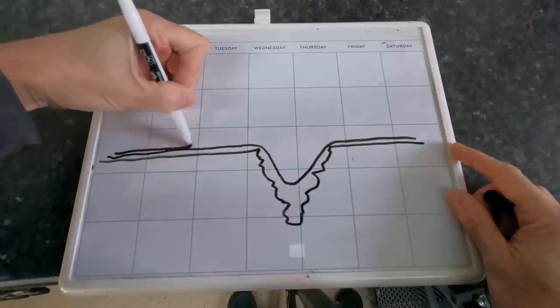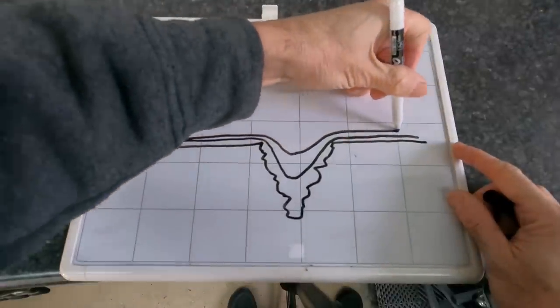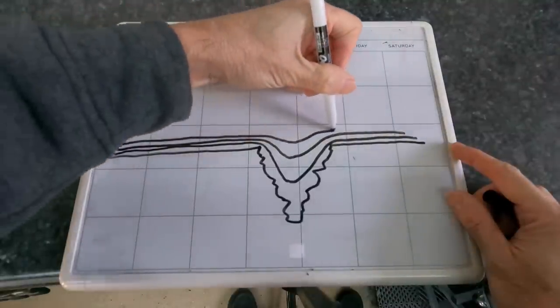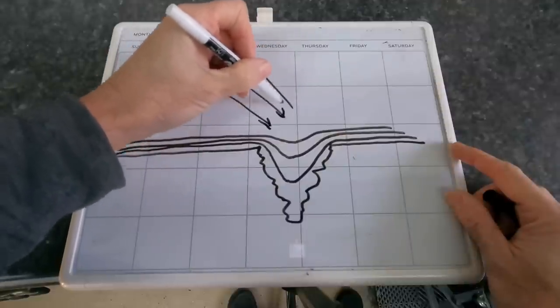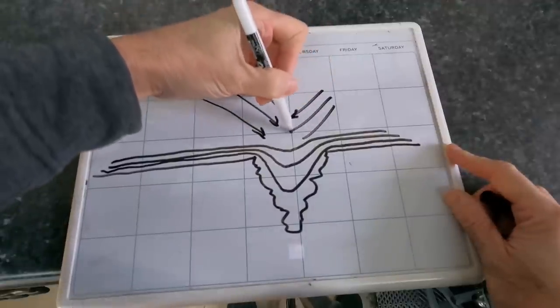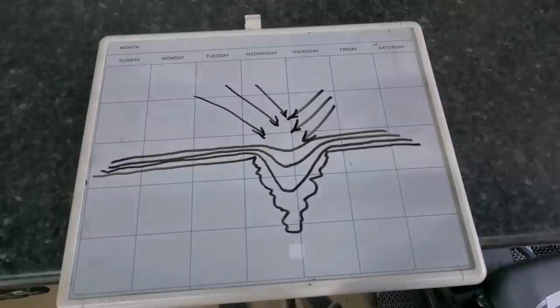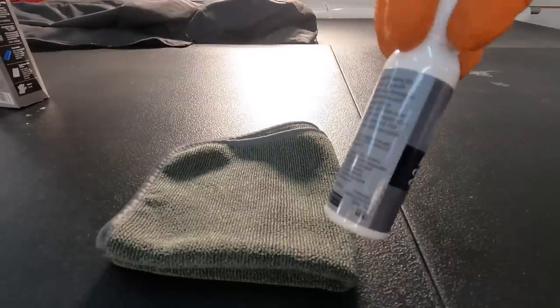The kit as a whole will round off the edges and fill the crevice of the scratch or nick. When light shines into the area, there are no jagged edges to refract off of and it looks less hideous. That said, the only way to truly repair the scratch would be to have a body shop sand it down and respray the area, but this is an excellent alternative.